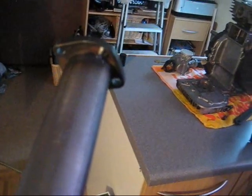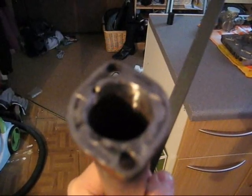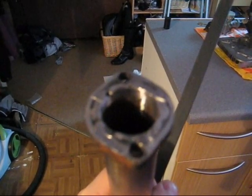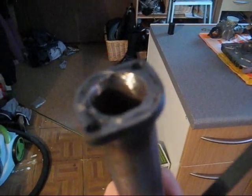As you can see on this exhaust, I've only got a small tack weld on each side. This was on the recommendation from a guy at work. If I'd butted it against the flange or put it through the flange and welded on the outside, I'd have had even more problem getting the bolts to sit, because that would have been right on top of the weld. So on his recommendation, I put the exhaust just a little bit out so there's a gap between where the exhaust pipe is and where it meets the engine block, and then weld into that gap and grind it down.